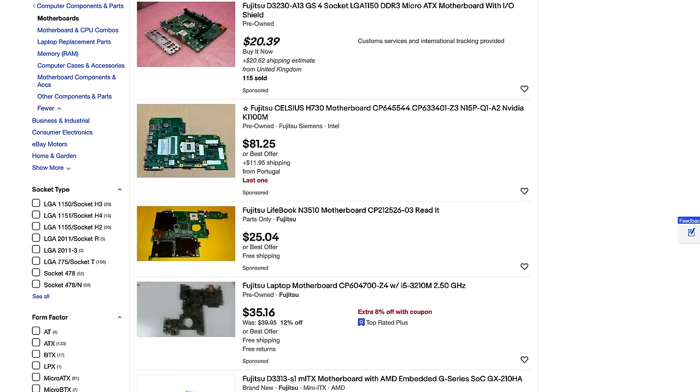My personal solution is to spin down the drives after a certain period of inactivity. However, spin-down is kind of a controversial topic — some people say that spinning your drives up and down causes additional wear and tear and can possibly reduce your drive's lifespan. But some argue this is not an issue anymore with newer hard drives. A user on Tom's Hardware Forums explains that most modern drives use loading ramps, which let the heads be retracted beyond the edge of the disc so there's no physical contact when the drive spins down. As a result, drive specs show ratings on the order of 300,000 stop-start cycles — that's a 10-year lifespan if the drives are stopped and started every 20 minutes every hour of every day, 365 days a year. Spinning down a drive brings power consumption from 3-8 watts down to less than half a watt, completely eliminates noise, and shouldn't have any appreciable impact on your drive's lifespan provided you don't spin them up and down every five minutes.